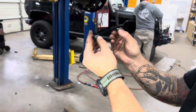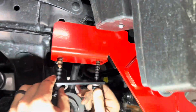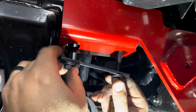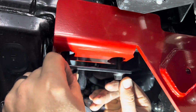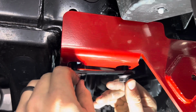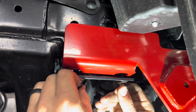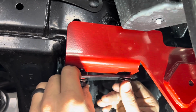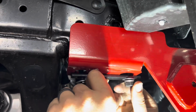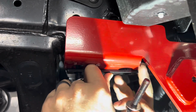Grab your 2 bolts and the nut plate backing and try gently starting the bolts. You cannot push up really hard because the nut plate is just floating around in there right now. Once one bolt starts, the second bolt's super easy. As you can see here, the rear bolt is the one that wanted to start.